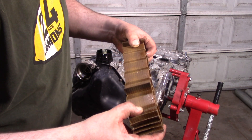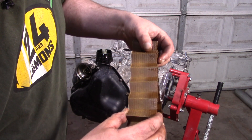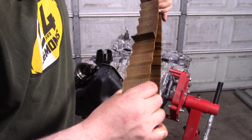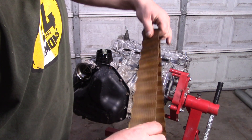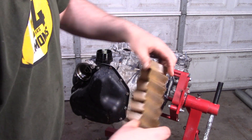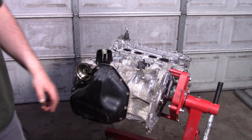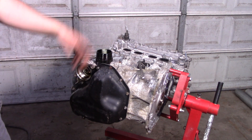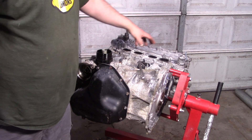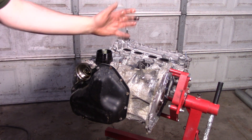Pressed out the filter element. This is just the epoxy from the ends there. We're looking for glitter. I am not seeing any — I think we're good, guys. I thought about that oil up there for a little bit. I bet this thing sat in a less than normal position for a little bit, probably in the accident, because it doesn't have an extra buildup there. It looks like it just got oiled down, like maybe the car was pointing sideways in a ditch.